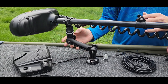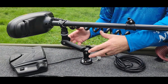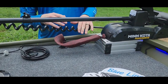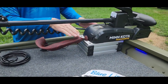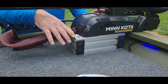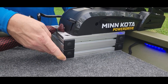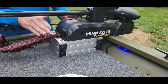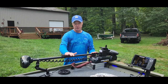I covered up some of the wiring with rod sock — I think it looks cool, has a really nice look to it. The real centerpiece is the motor mount bracket. A buddy of mine built this for me and just went above and beyond. It's 80-20 aluminum channeling; the top and bottom are both 3/8 of an inch solid aluminum. It looks awesome and it's not going anywhere — you could run a Humvee over it and it would not move. That's the power system on the front of the boat.